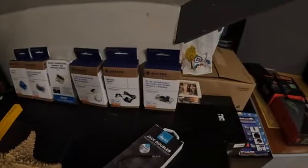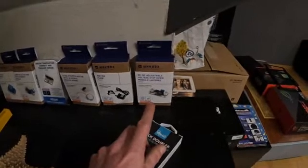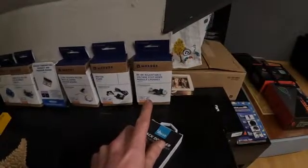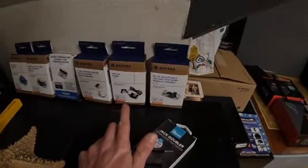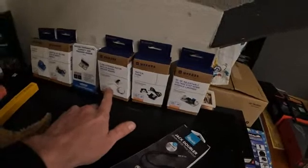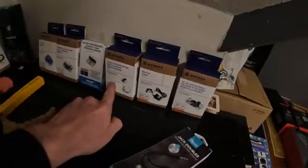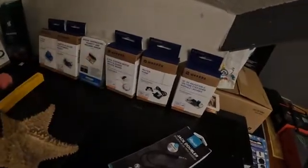Okay, so these are the sensors for the scooter. We have the voltage step down regulator to get like USB charging or 12 volts, because the batteries we'll produce will be 16 volts. Very powerful batteries. Then we have a water pump just for testing. I'm using one of these. Of course we're gonna use another quality pump from Malossi or Polini. Then we got the stepper motor to control the ignition of the Malossi CDI. You can switch the maps. This will be done electronically to retard it or change the ignition timing.